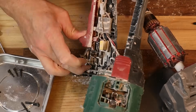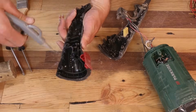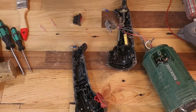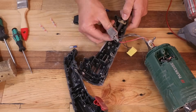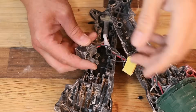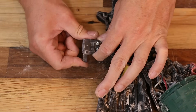The first step for me is always cleaning the machine. I use a vacuum, some compressed air, or a wet towel to clean the machine from the outside. Then I disassemble everything, clean it from the inside, grease the bearings, and so on, so that I can see what is going on inside — what is up with the machine, are there different kinds of failures in there? And the most important part during disassembly is that we get to the switch.